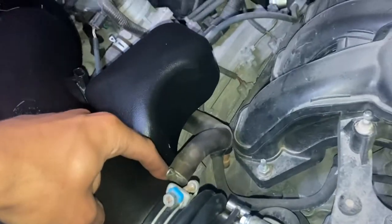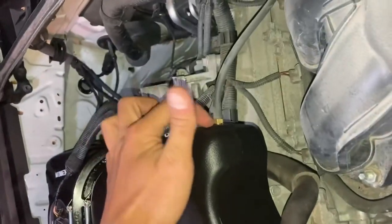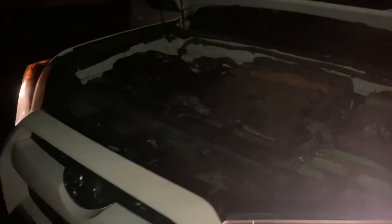Once you get the coupler on, install this tube that connects your box to your engine. It slips into the air filter we put on earlier, then tighten the clamps. Attach this tube back onto the fitting, and attach the other tube onto the fitting that came with the kit. Important detail: the box comes with gaps spaced evenly, so tighten this down until those gaps close so that it doesn't pull out easily.